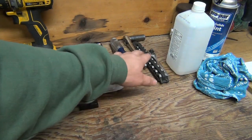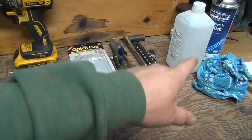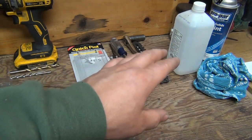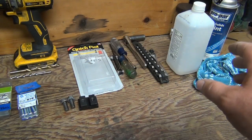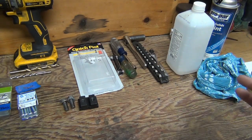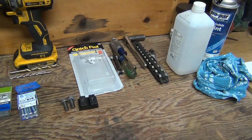You're going to need some hand tools — just the basic stuff to tighten your fasteners. You'll also need some paint and something to clean your brackets, to get the grease off and dry them before you put your paint on, otherwise it won't stick well. I used a good quality high-solids paint — the better the paint the longer it'll last and resist fading. Just a rag and alcohol or brake cleaner — basically whatever doesn't leave a residue behind.